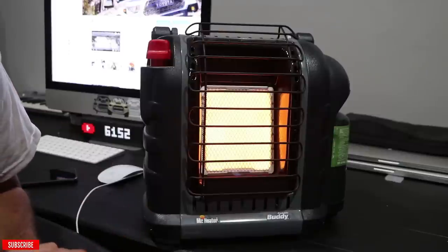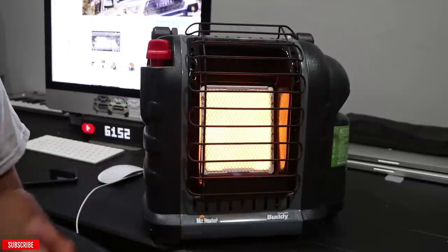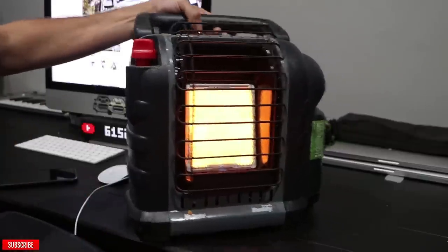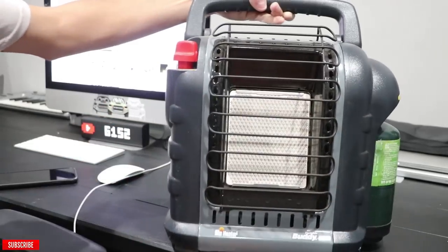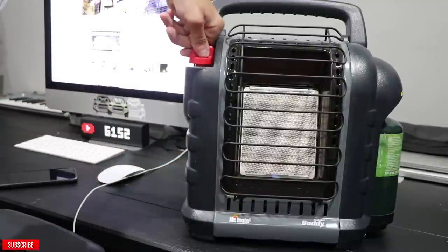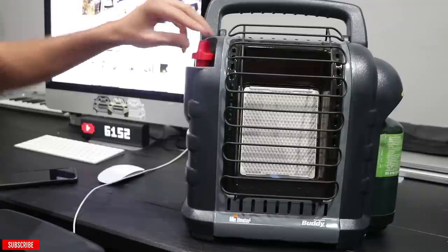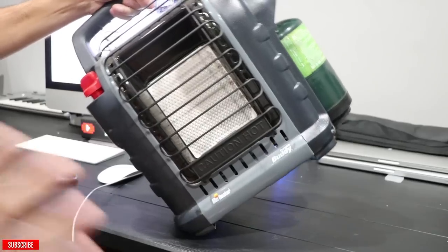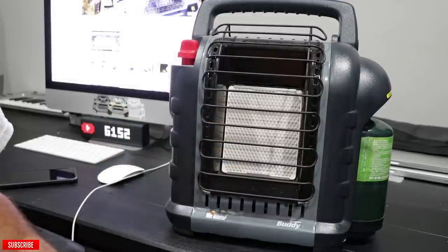Another big reason why I chose to go with this Mr. Buddy Heater was safety. This thing is super easy and super safe to use. As you can see, it is on right now. Let's say you're inside your tent or room and you hit it accidentally, or a cat knocks it over — as you can see, if it gets tilted it automatically shuts off. It does have a small sensor inside so if it tilts over for any reason, it does shut off. So I'm going to show you again — the igniter is on, I'm going to twist it to the low position and tilt it over to the left. As you can see, it did shut off. When it comes down to safety, especially when dealing with propane and gas, the last thing you want is to not wake up in the morning because your heater leaked — and yeah, that'll be bad news.